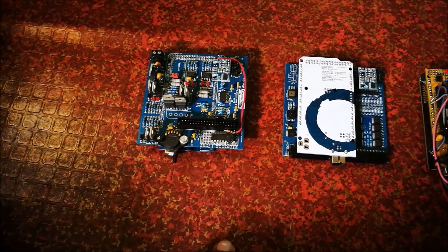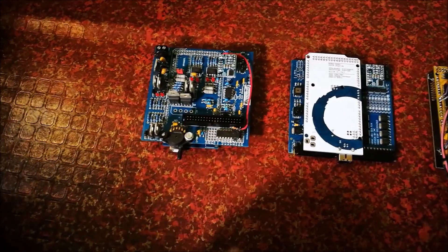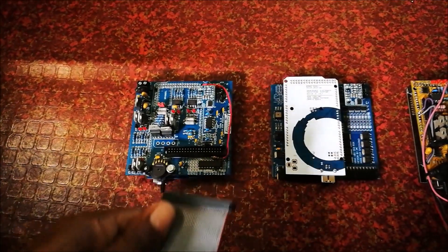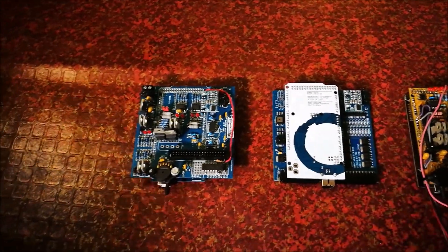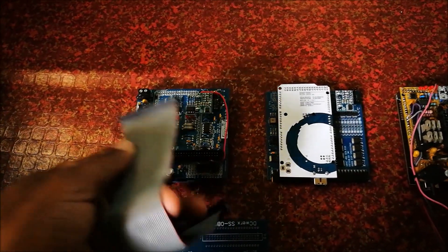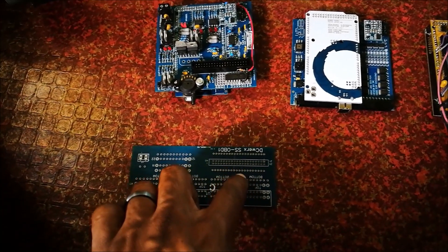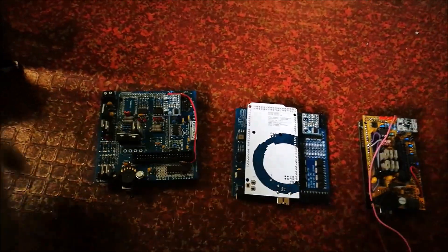For the v0.4 outputs or harness breakout, it uses an IDC 40-pin connector, which is made for ribbon cables. The ribbon cable plugs in here and goes into whatever you want. I made a couple of boards — like the SS OBD1 — where you'd have an OBD1 connector, plug this into there, and the other end plugs into here. You do your wiring on this tiny board and then plug it into your car via jumpers.